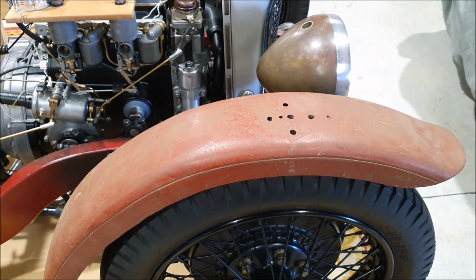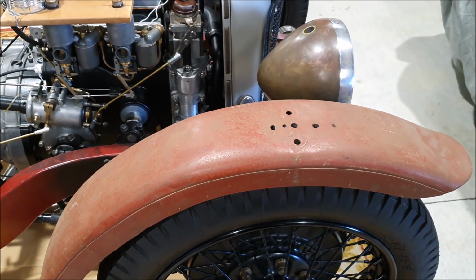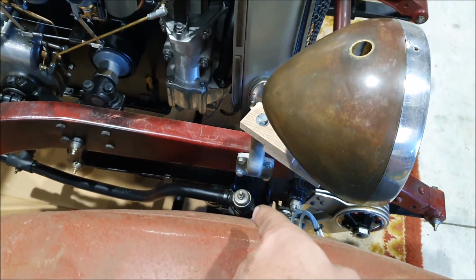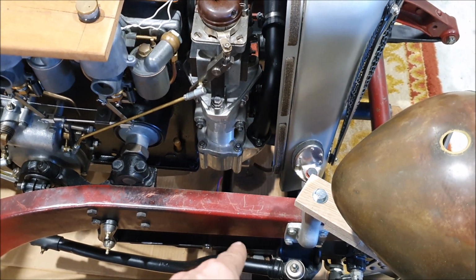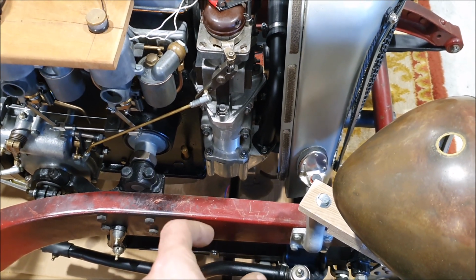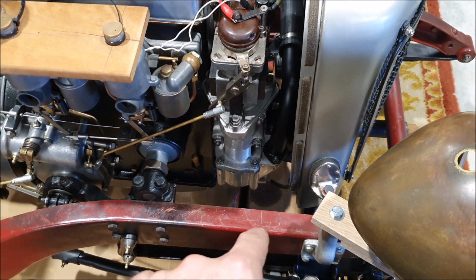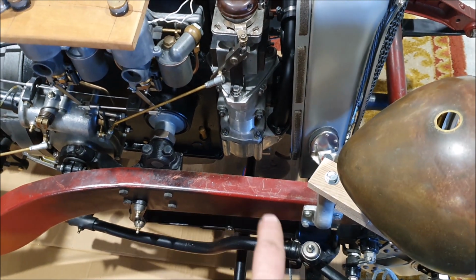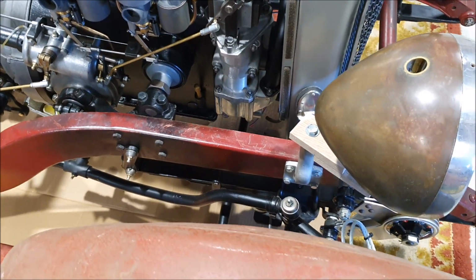What I'm trying to figure out at the moment is how high they need to sit above the wheels and where the guard stays will go. So the front, there's a stay at the top and it goes down on a diagonal, and I need to make a plate that bolts to the chassis, and it's got a short section of tube welded to it. And the guard stay actually fits into that. There's a hole through that mount, and the bottom of the guard stay is threaded, so it drops down into it, and there's a big nut on the bottom, and that's how they bolt the front guards on.